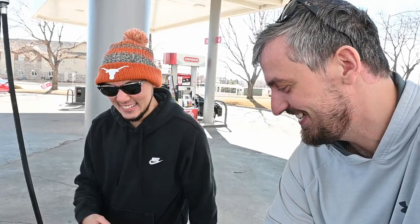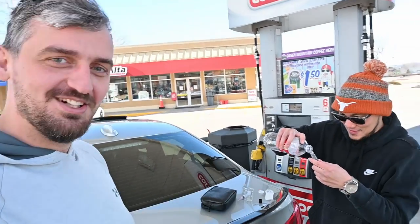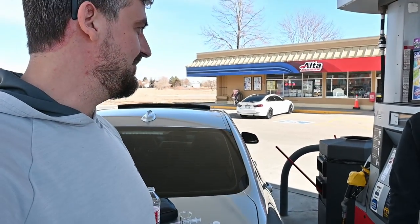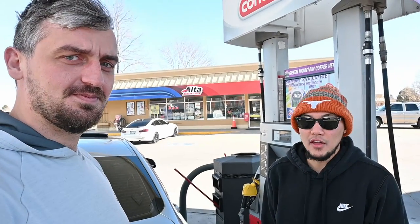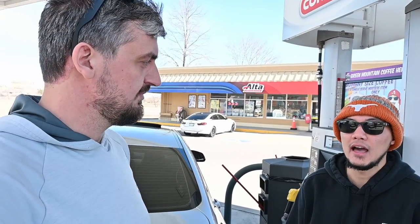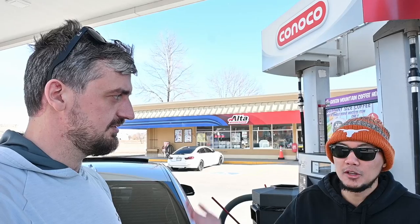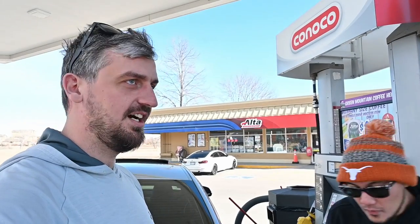If anyone ever told me if you want a fast car, learn chemistry — we never would have known. Since we're on the Car Noob channel and most of us here are car noobs, how important would you say an ethanol mix is for going faster? Most cars love ethanol. If you're boosted, 100% I recommend ethanol. If you're naturally aspirated and don't have a high compression motor, you won't make as much gains, but there's still gains to be had because ethanol allows so much more timing and it runs cooler. But you do lose MPG, so if this is your daily driver you will see a significant MPG drop with like e85.